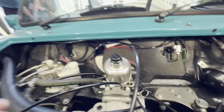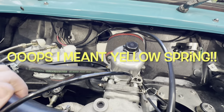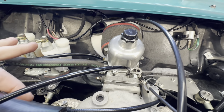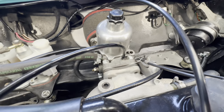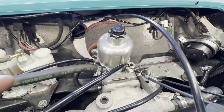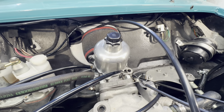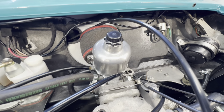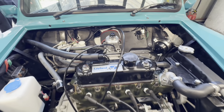So, got this one dialed in. Already had a yellow spring in there, 2885 quick drop damper. Had to drop the oil from 2050 down to 530 because it was too rich when I throttled it. And we went up from a BDL needle to a BDR. And then I had to do quite some extensive modifications because it had a very, very tight lean spot between about 3 and 3,750 revs, which I got there in the end, but took quite a few goes on the needle. So we'll let the owner go out in it and see what he thinks.